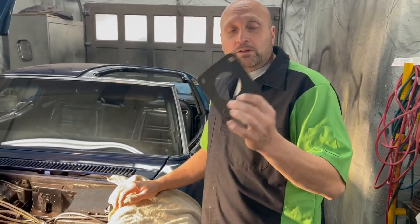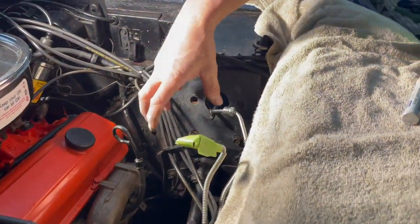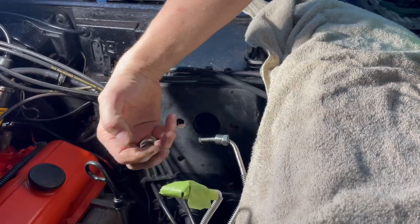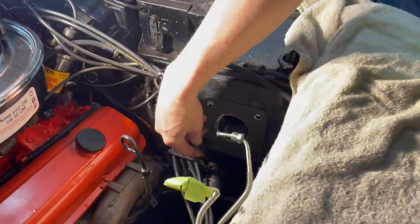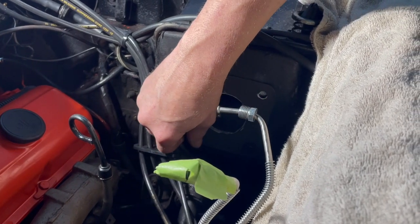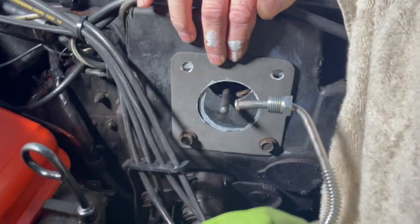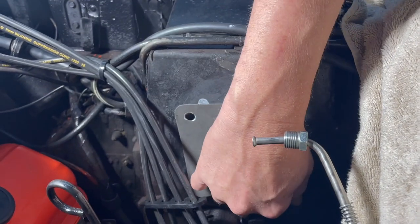Getting back to the brake setup — the gasket I told you to pick up off the bench, you're going to bring it over here. You'll already have your old master cylinder off. There'll be two bolts up top — just knock them out and let them hit the floor. There'll be two bolts at the bottom you'll loosen and take out. Now that we've taken those bolts out, we're putting this gasket in place. From there, we're going to use a paint marker and transfer a line around where the bolts are up top. I've already done that. Now I'll take that gasket back off.